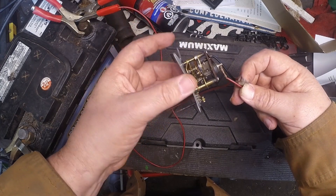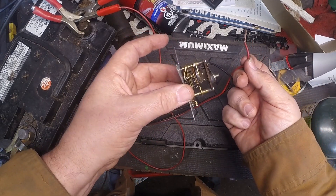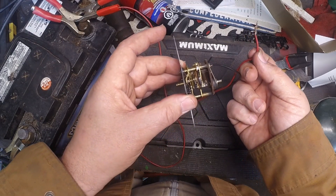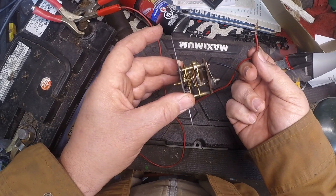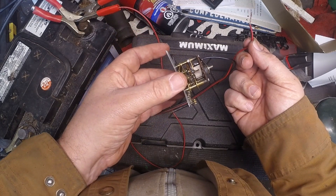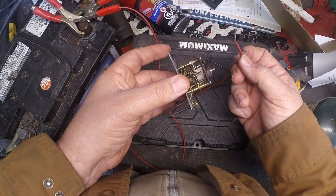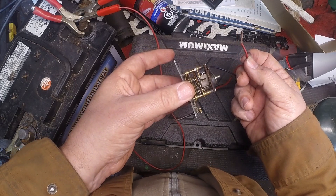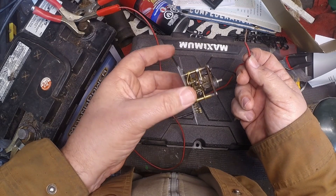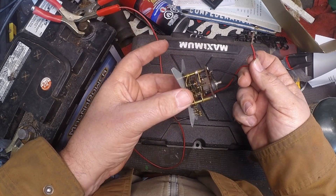I have my clock working again. Like I said, if you take the wire off it still runs a bit - apparently so you can disconnect the battery to swap it and not lose time. But you wait long enough, those contacts get closer and closer, and as soon as they touch the clock stops. But that wire keeps them apart, probably some kind of magnetic field. It works great. I'm just so thrilled - all I had to do was basically clean it up, lube it, and the clock works again in my car.